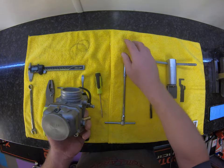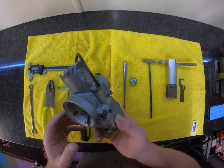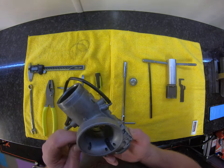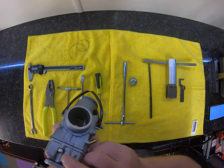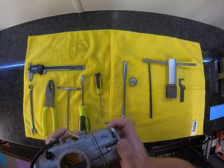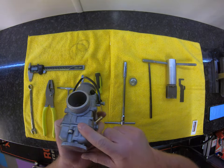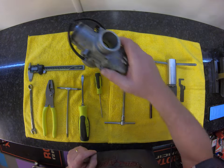Generally it comes with this, so you'll need a 19mm. Basically guys, just keep it clean. A lot of you would be buying bucket loads of carburettor cleaner — don't use it. What you want to use is brake cleaner; it doesn't leave a film across the carb. What we'll do is go through stripping it and rebuilding the carb, then show you some things you should be aware of.